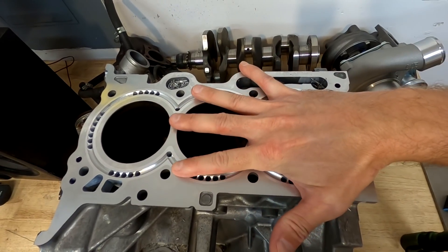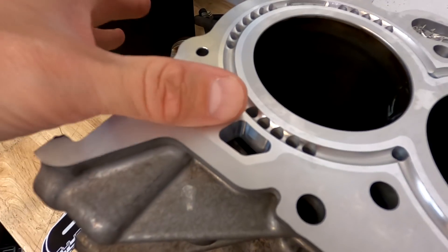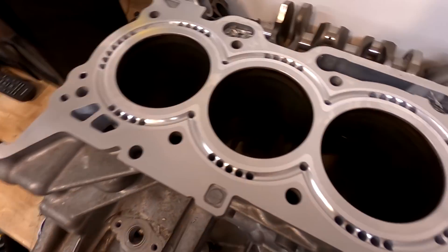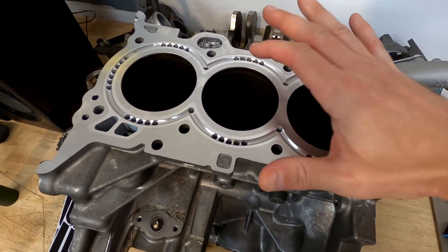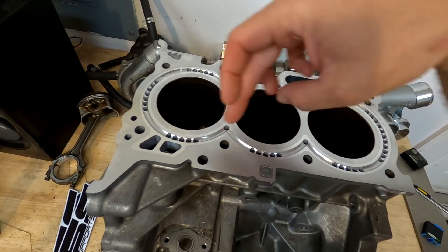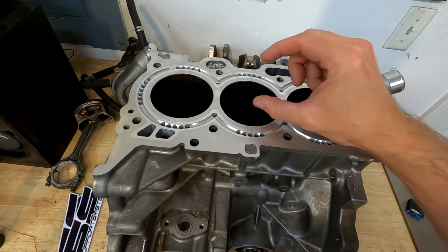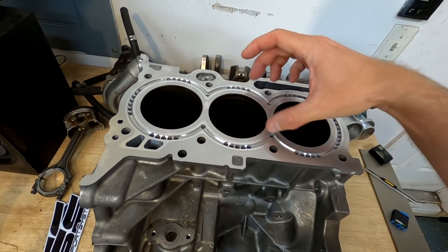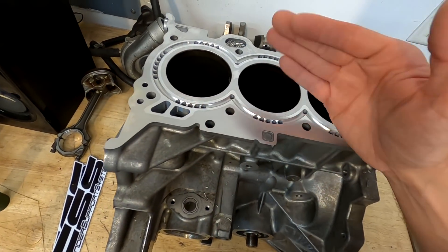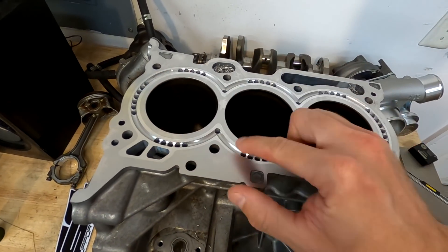On camera this engine block looks a lot larger than it is — my hand is almost the same height and size as the whole engine block, and my hand is the size of at least two of the cylinders. Look at the size of my thumb compared to these passages — the precision work that's been done on this is really something else. The cylinder support system is not just a block guard. A block guard is a rough fit that relies on a cylinder taper and just protects the top portion. The cylinder support system is machined precisely into the water jacket, giving consistent support from the very top of the cylinder to the very bottom of the rings.